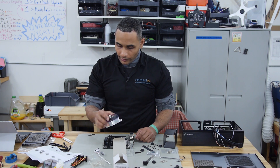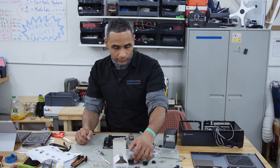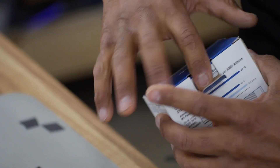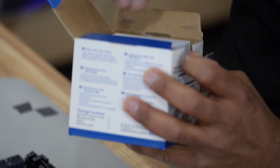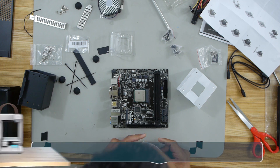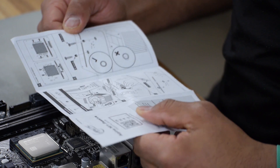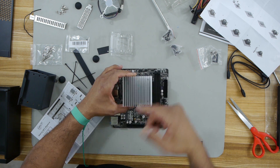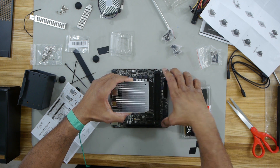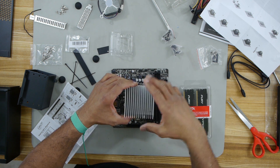It came with this stock heat sink — it even had thermal grease on it. It has a fan, but I got this larger heat sink so I can have a passively cooled system and won't need the fan. This thing is pretty stout. It's already got thermal paste on it. I've got to figure out how to put these locking screws on here. I also have to keep in mind the airflow. With the big fins, if the air moves this way, the RAM might impede it. If I orient it this way, there won't be anything blocking the airflow.